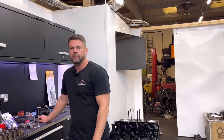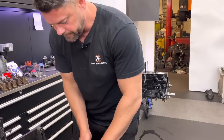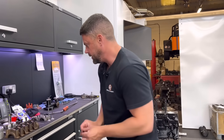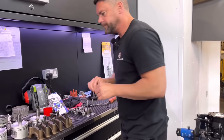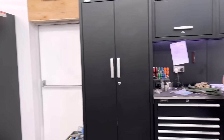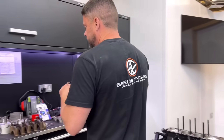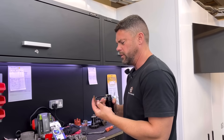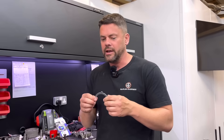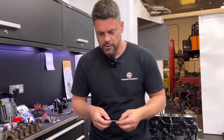Job done. But I've had to wait a day for those to come. I suppose it'd be quite easy to get confused and think you're going to end up with 10 thou. So what we'll do here, get a bit of oil. Now, one thing you've got to be very careful with thrusts is it's easy to get confused putting these in the wrong way round. And if you do that, you've got the steel backing running on the steel crank — it's going to scrap it. It's going to get pretty hot.